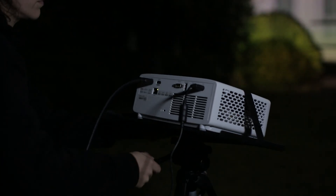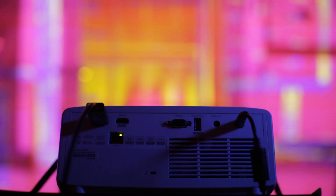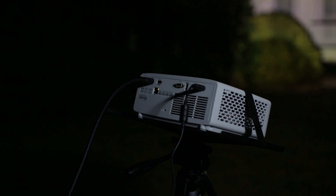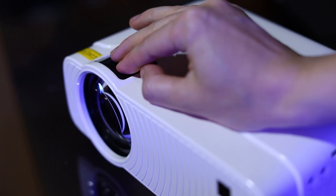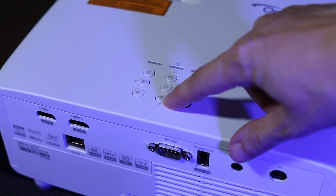I'm using a short throw projector. My house is around 12 meters wide, which is approximately 40 feet, and I've had to set up my projector around 6 meters away, which is approximately 20 feet. Notice how I've had to tilt my projector down. This is very common because many projector lenses are shifted upwards, which is useful if you have the projector on a table and are projecting a presentation up onto a wall. But I want the projections to reach the floor, so I need to tilt the projector forwards. If your projector's lens can be zoomed in and out, just double check that it's fully zoomed out. Also ensure that you haven't got any keystoning applied if your projector supports that function.